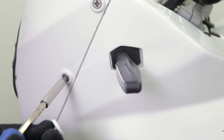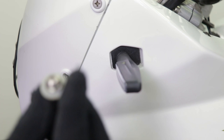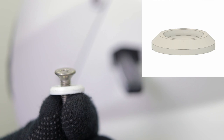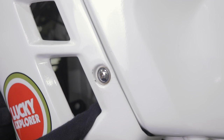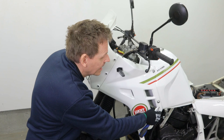These bolts are not the original ones — this was what was on the bike and I'm not sure if these are original either. I wanted to make something a bit slimmer, so I made my own design — 3D printed a washer — and used bolts with a chamfer. This washer now fits perfectly into them so they get a bit slimmer. Also, this washer is much whiter and fits better to the bike. It seems like the previous owner put all kinds of random bolts to attach the fairing — some are even too long and bottom out before they actually hold the fairing properly. I'll replace them all with the same bolts everywhere.